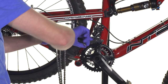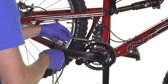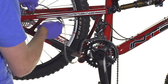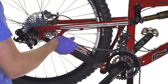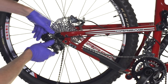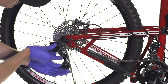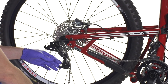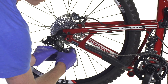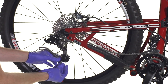I have the front derailleur shifted into the larger of the two chain rings, and then we'll just get the chain on there and feed it through, get it to about there. Then we'll run the other end over the cassette into the small cog, and then if you have a SRAM Type 2 rear derailleur you'll want to push the derailleur up and press in the lock to hold it in place. That's going to make this a whole lot easier. So then take the chain, thread it through, be sure to get it up and over that little piece of the derailleur cage, and down through here.